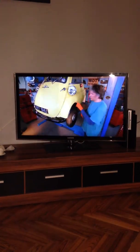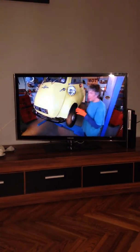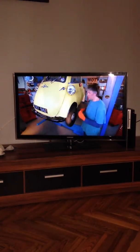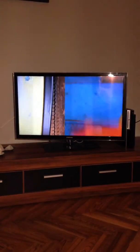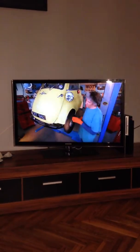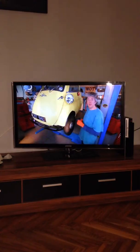Before I do that, I'm going to have a look at these front wheel arches. We know we're going to be changing these rear wheels that are on the front of the car for the original front wheels. The main difference is the offset — at the moment, these wheels sit a little bit further out of the wheel arches. The stock ones actually sit neater inside the wheel arch, and that means you no longer need this rather nasty flare.